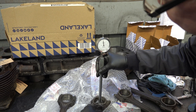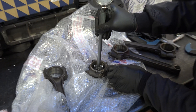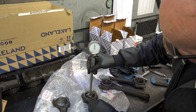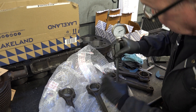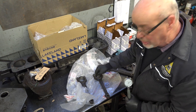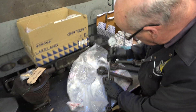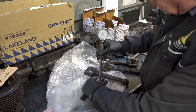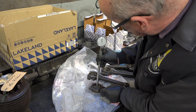That one's slightly more but still less than a thousandth of an inch — which is fine. It's almost one thousandth of an inch over one way, and half a thousandth of an inch over the other way, so there's half a thousandth variation. I could probably improve that slightly — I could grind the face of the cap to let it in a little bit closer and then hone it back out to make it rounder — but it's so little it's not really worth the effort. Last one... dead on zero. Wow, that's very nice — half over the other way. So far, beautiful.